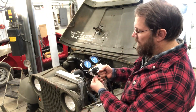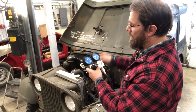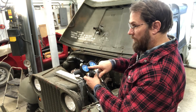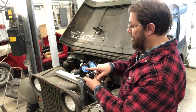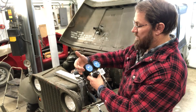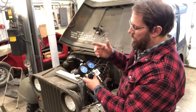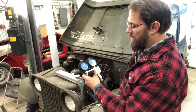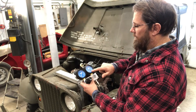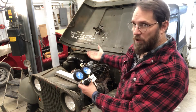What this tester does is you pump air in here and it goes through the gauges into the cylinders. You set the pressure you're putting in via this gauge, then you read the reading on the other gauge - this one shows amount of air going in, and this shows how much it's actually holding. The easiest is to just do it at 100 PSI: if it's showing 80 then you have 20% leak down, showing 70 means 30% leak down.